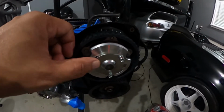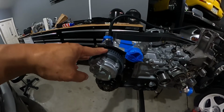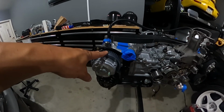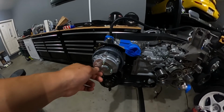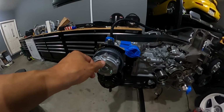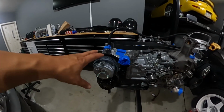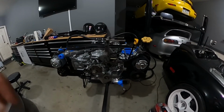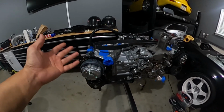So I got the intake cam sprocket in, got the new hardware on the cover. Did the same thing for the other side. So just gotta, I already torqued this guy. So 21.8 foot-pounds and another 45 degrees. Gotta torque these guys. I gotta be real careful now. So once I get that done, timing is next. And I'm not gonna show you, you know, the routine of how I did all that.